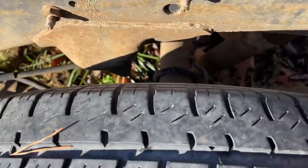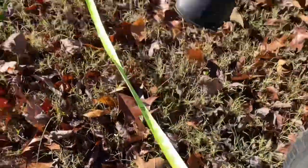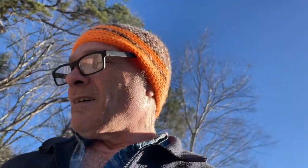That can be made up very easily, the difference in that. You could put offset axle perches on the leaf spring to make up an inch, or you could set the bed an inch back from the cab. There's all kind of ways to make up that difference. So that's what you want. You either want the long bed S10 or the extended cab S10 will have close enough to the same wheelbase